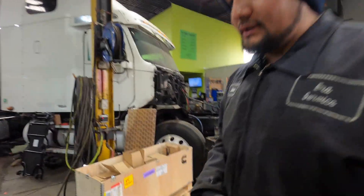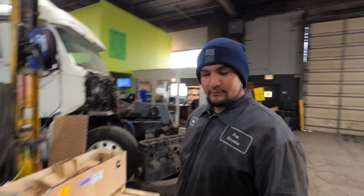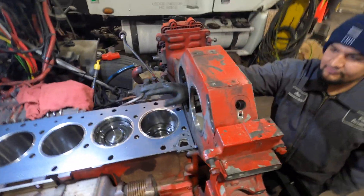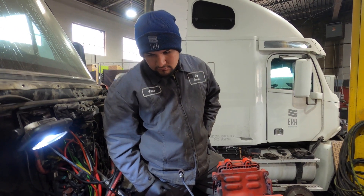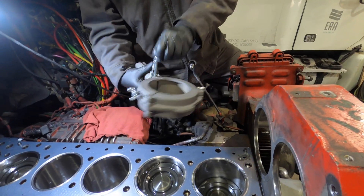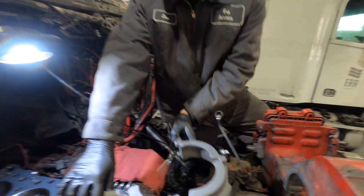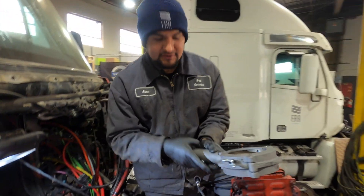Clean, blown out, ready to get installed right now. We got the head gasket installed. Liners and everything are obviously already installed from yesterday. When you were putting the cylinders in, you want to explain what you did? We got the piston ring compressor — this opens up, we install it on the piston and it compresses the ring so we can install it into the cylinder.